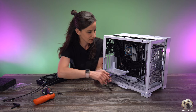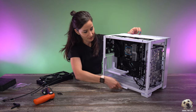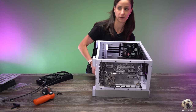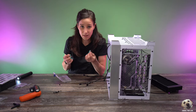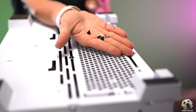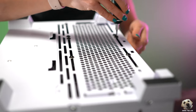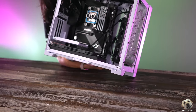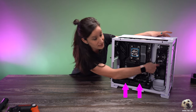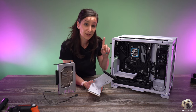Now we can get this last radiator in place — we're going to take the dust filter out. I'm going to put it completely upside down. Normally when you screw the radiator directly onto a PC case I always use washers; I'm not sure why washers didn't come so I'm just going to use some — it's better to have them than not. To recap: on the bottom we have intake, along with the side, and on the top and in the rear we have exhaust.